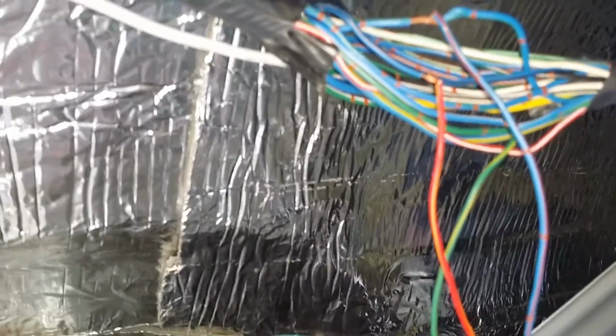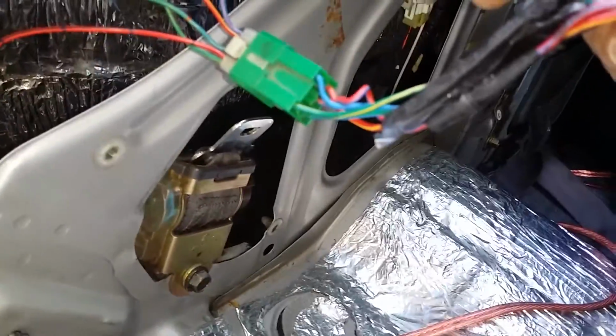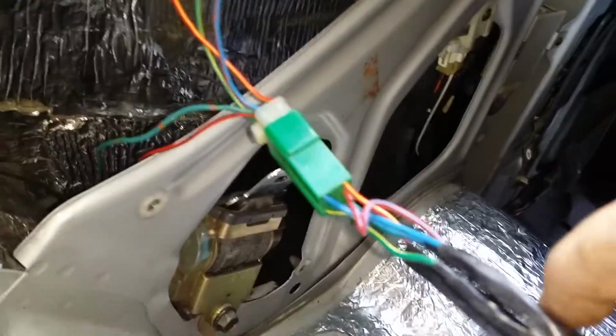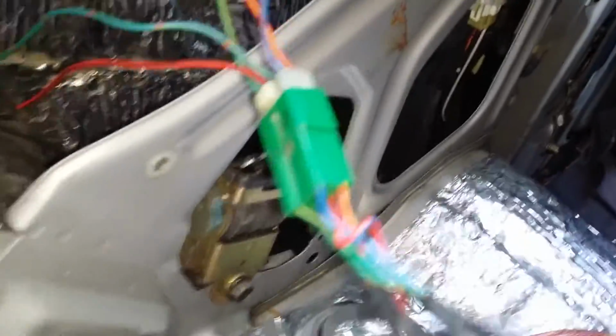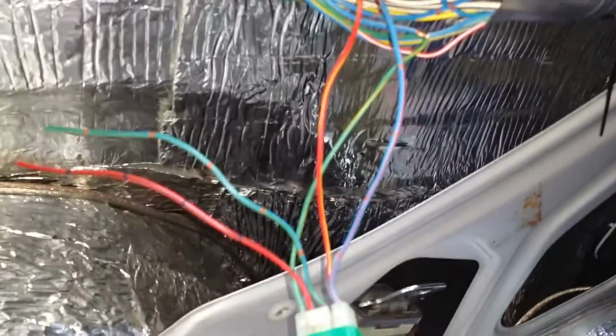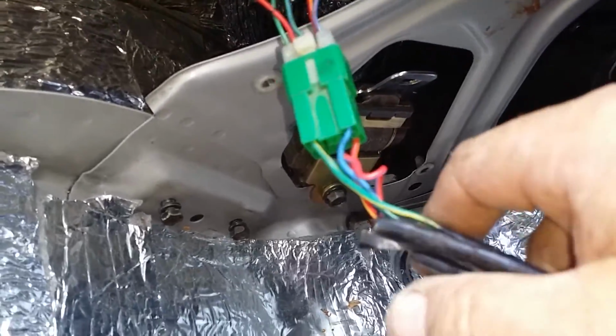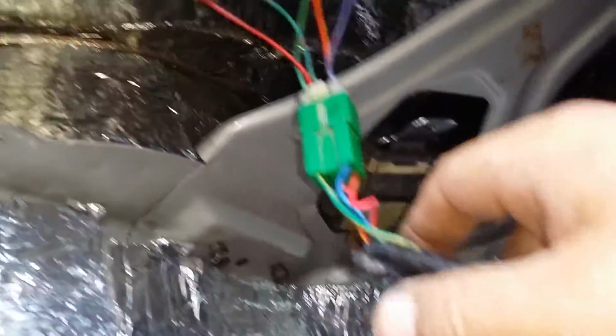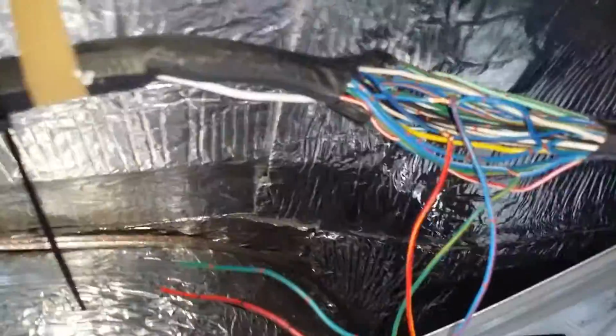So just as I said, off of the back of the switch connector, if you have a separate connector, this is for a modification if you're taking both sides of the switch and the connector side. I always take those at the yard because people are hacking the crap out of them anyway, and they just mutilate them. So I take as much as possible back to the harness. This way, I knew I could do this eventually, but also it gives me some wiggle room, which I definitely needed when I did my triple stakes with the added switch in the middle for the onboard air. Okay, so once again, off the back of your connector, you have a blue wire with a red stripe.